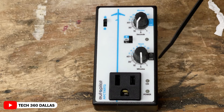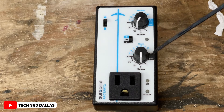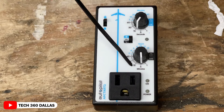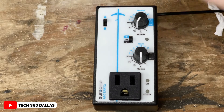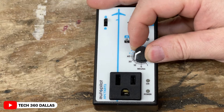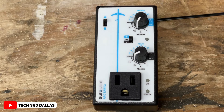The off setting goes from one minute all the way up to 14 hours, and there are a whole lot of different settings you can choose. So let's say you want this thing to go off every 30 minutes — you'll take it and basically turn that knob to 30 minutes. If you need to be precise and have exactly 30 minutes, you may want to use a stopwatch and after the cycle ends, verify that it is actually 30 minutes.